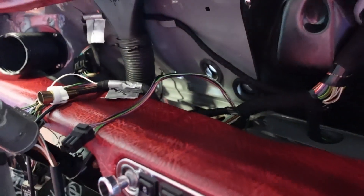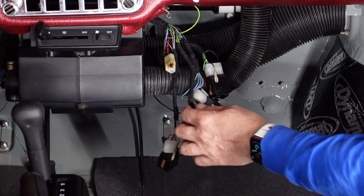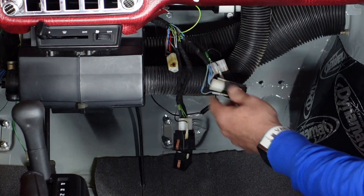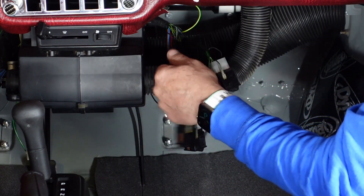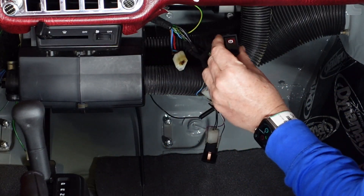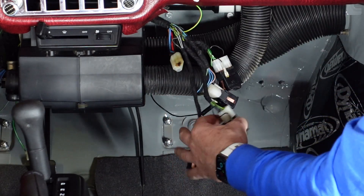On the far side here is the plug that connects the main harness to the rear harness as well. I'm trying to separate these switches to make it a little easier for the switch panel. I'm doing it purely on logic — there are groups of greens and blacks, groups of blues and greens, groups of whites and blacks, and then a group of green here. This one looks like it's had some burning issues, so I'm actually going to replace that plug. The wrapping should make it a bit easier to deal with them because it was just a jumbled up mess.